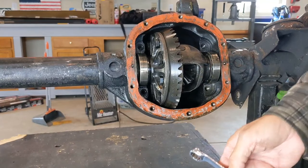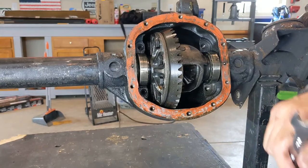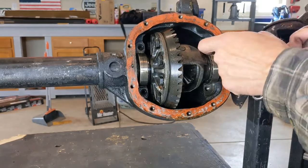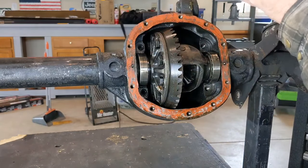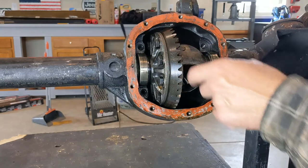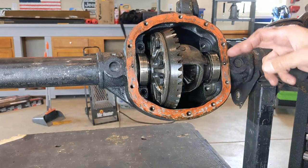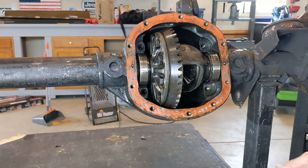I'm working on a high pinion axle, so the wrench would have to go on the low side. On a low pinion housing, put the wrench on the high side. If the carrier still won't come out, make sure you have your wrench on the right side. Another reason the carrier might not come out — and I've seen this happen — is forgetting to pull your axle shafts out. You start pulling and can't figure out why it won't come, then realize the axle shafts are still in. So make sure you have all that stuff prepped.